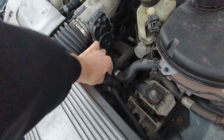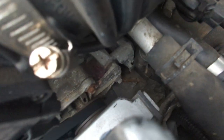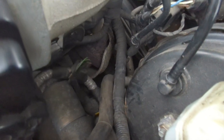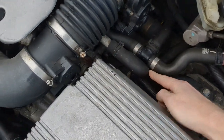That's the hose in question that was collapsing. We need to identify first why it was collapsing and causing a bit of overheating. You can see there's the water pump - it's had a coolant leak in the past but it's been remedied. The water pump itself, although it's not leaking at the moment, potentially has done in the past; there are some pretty rusted-looking bolts. A lot of the pipework is new - that T-piece is brand new - but the pipework to the heater matrix is original. The pipework I replaced was about two and a half years ago, so around six to eight thousand miles.